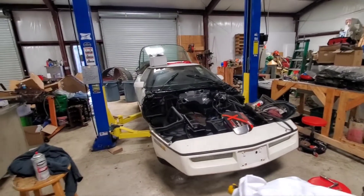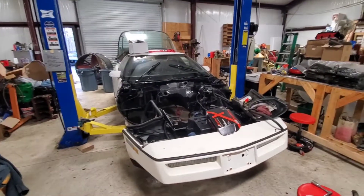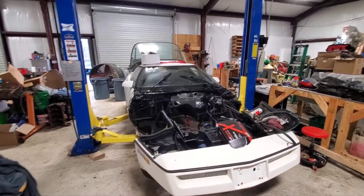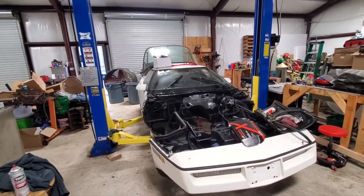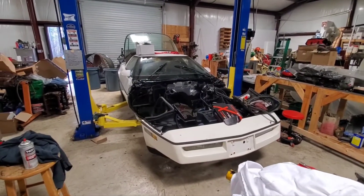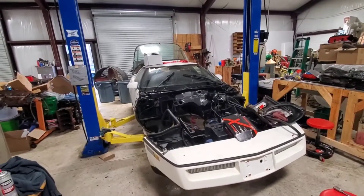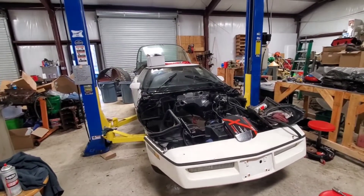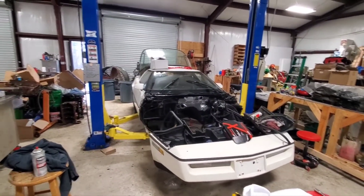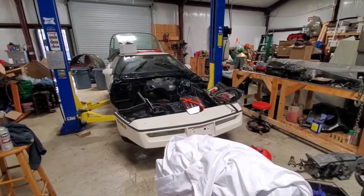The cam is a Stage 1 Summit turbo cam — we got the kit that came with the springs and all the other cool stuff. I watched Richard's video on Stage 1 versus Stage 2, and we almost went with the Sloppy's Best cam actually — I was looking at that and kind of wanted to play with it — but after the numbers came out it was unobtainium, so we went with the Summit cam. Heard a lot of good stuff about it, looking forward to using it. The Stage 1 made a little bit more low end and didn't seem to give up much up top — not that that's a big deal with the LS1 intake we've got right now anyway.